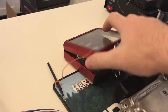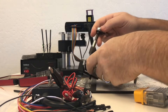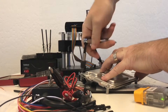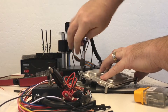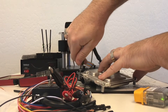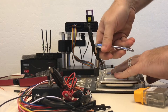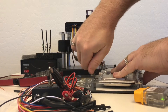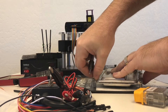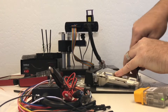The first part is we need to open the ECU. The ECU has already been opened so it won't be too hard to pry apart, but typically after you get all the screws off, you want to take a heat gun and go around all the edges. Really heat up the outsides because that's where you have the sticky black silicone. Then use flat putty knives to carefully pry open the ends slowly, using a razor blade to slice the black silicone. Make sure you don't slip or go in too far because you can damage the circuit board — if you break off a diode, a capacitor, or scratch a lead, that ECU is done.